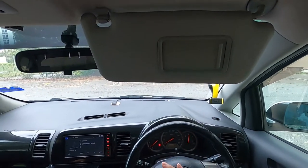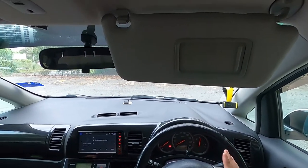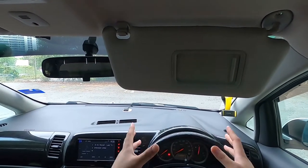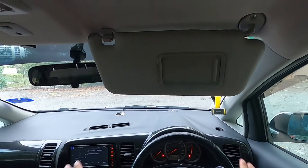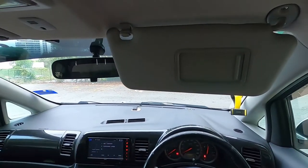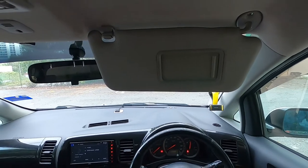How to tell if you have tuned your subwoofer in a good way is when the subwoofer sounds, but you don't feel, you can't tell where the direction is. Then your tuning is already right, because the subwoofer is blending. But if the subwoofer sounds sharp, which means you can tell the direction of its sound, then your tuning is not right. There's something that has to be perfected in there.